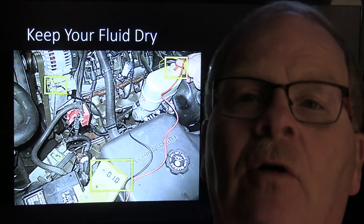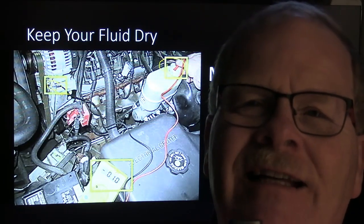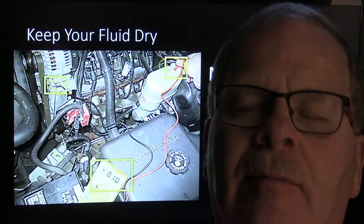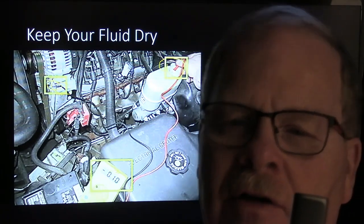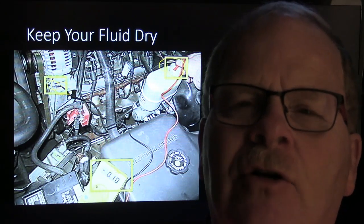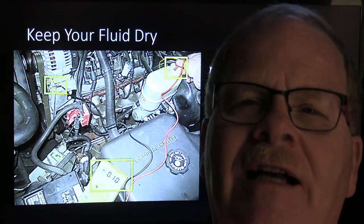And again, if it's got drum brakes on the rear, if they're not adjusted right, like if they're not adjusted out really close to the drum, you're going to wind up with a brake pedal that you hit once and it goes too far, and you hit it a second time and it catches over close to the top. And so it's real easy to think you're done with the rear brakes when you're not.